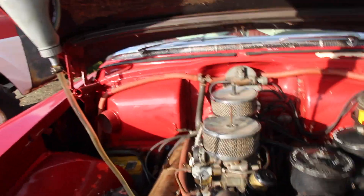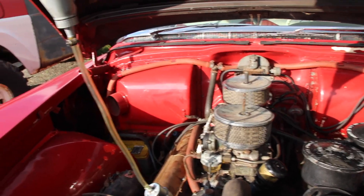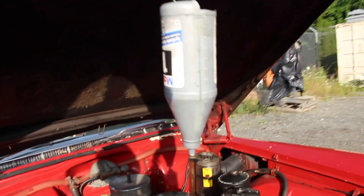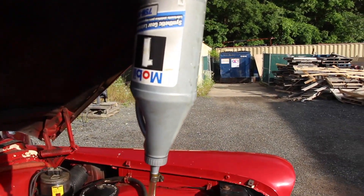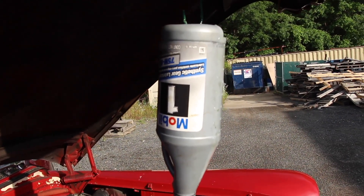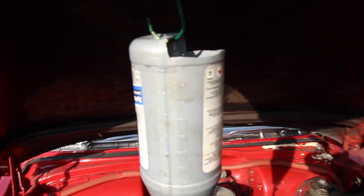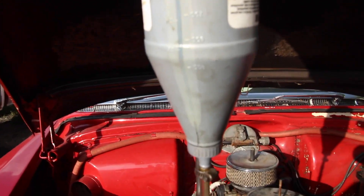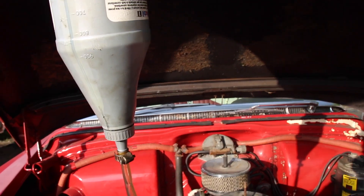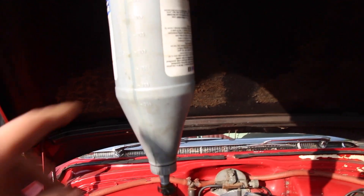If you're doing this at home and you don't want to run the old gas from the tank, you just want to gravity feed it. The best way I've figured out, and one that probably won't cost you anything, is to get a bottle like this — usually it's for gear oil or something for a differential. I always just cut a hole in the top to pour some gas in. These are really good because the caps are tapered and you can put a hose on the end and they won't leak everywhere. I used to do water bottles but they always leaked. These work really well.